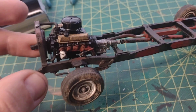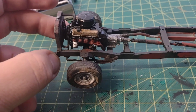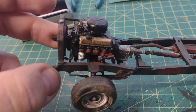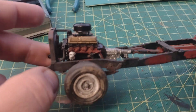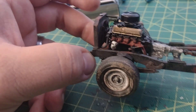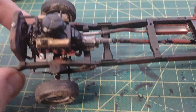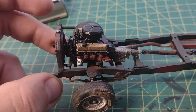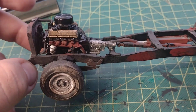I do want to bring up an issue I had with the engine in terms of mounting it. The front peg that sits on the front crossmember was a little high, so it was causing the engine not to sit down all the way and pass below the radiator shroud. So what I had to do is cut off some of it to where it would drop correctly. It is now clear — it was causing issues with the hood not closing all the way, the hood was basically floating onto the cab. So I remedied that.